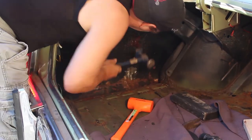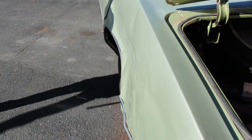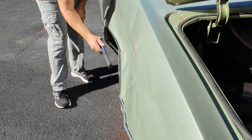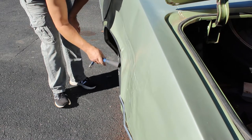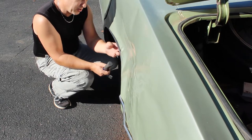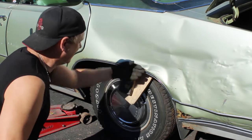Again, put a block on the outside. One of the other problems we have: we've got this back area straightened out, but this section comes way in here — you can see that's where the wheel is supposed to be. The fender is in about three and a half inches, so I've got to get this out. Actually it rubs — I can get a hammer up through right there. It touches, so when I go over a bump it touches the tire. So I'm going to have to get some stuff back here and pry all this out. You can do this with a slide hammer or slide puller, but I don't have one, so we're going to use pieces of wood and a hammer.